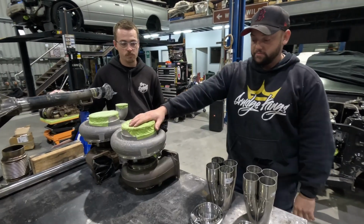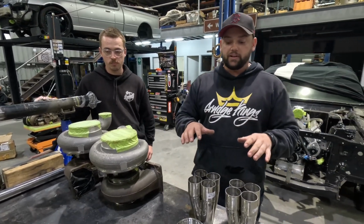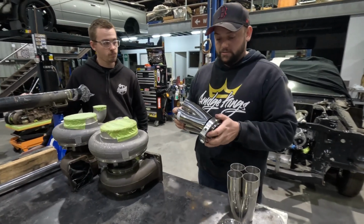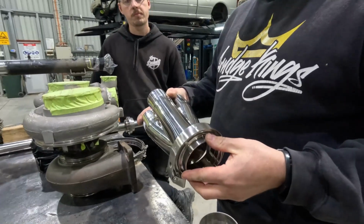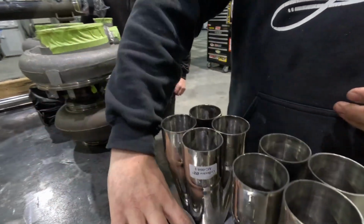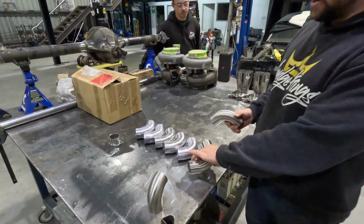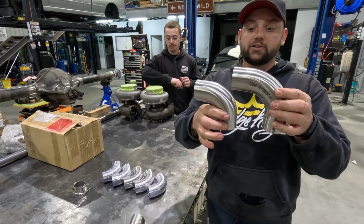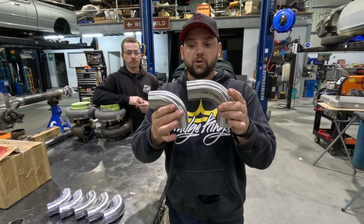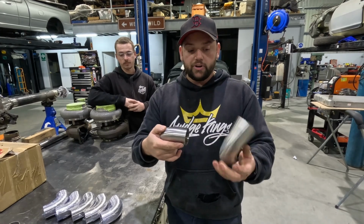For starters, we need to make sure that the pipes are going to work, how we want to have the orientation, how we want to run the pipes and everything like that. So Will is probably going to jump onto banging some of these V-bands onto these collectors. He'll weld that up, and then we'll get these in the right spot. And then we can jump onto the primaries, which we're using a whole bunch of different styles, but you've got your long radius and your short radius. This is 1-to-1 on a 2-inch, so it's a really tight bend compared to your more conventional long radius bend. But both 2-inch, both the same grade material, both 316.